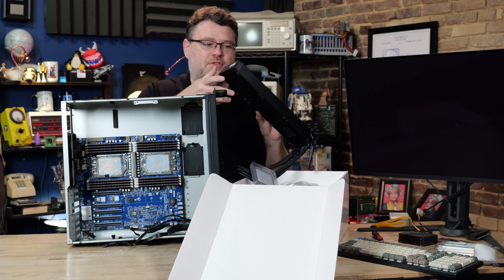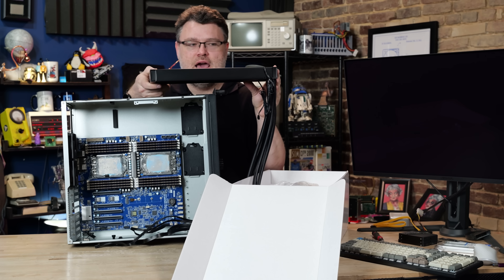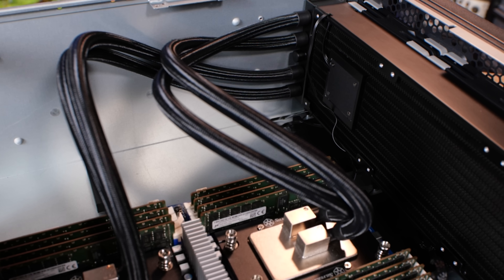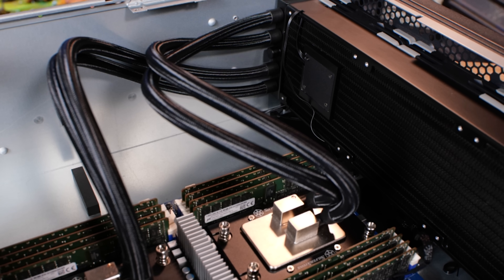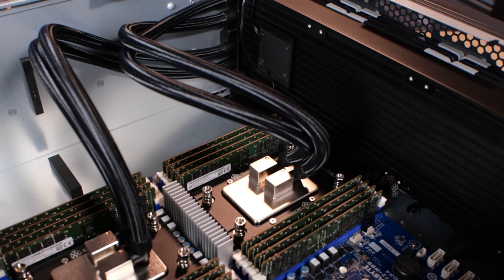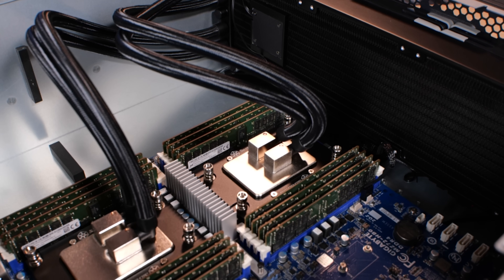This cooler is thick and it's designed to dissipate up to 800 watts from two processors. It's also a dual pump design — pumps on both sides, one for each CPU, which keeps the pressure up. I found that this cooler works best in a push-pull configuration.